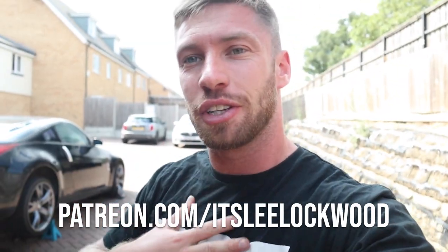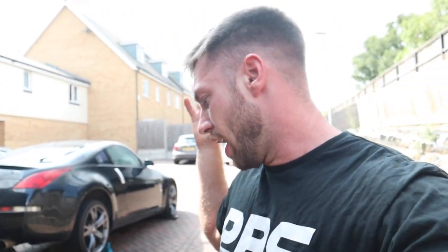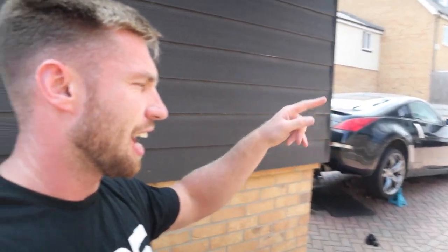Today we're coming on for the last video. In the last episode, we went and got a locked diff for the 350 because this diff in here is actually dangerous. I went over this in a video of why these 350 diffs are dangerous — in my opinion, actually dangerous — and they're 100% terrible to drive with. I couldn't find the correct gear oil in the last episode because Halfords only did part synthetic, and I wanted full synthetic because we're going to put the diff through a bit more stress. Now it's locked as well, so we want some good oil in there. I've managed to order full synthetic 75-90, and it's inside the car.